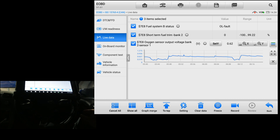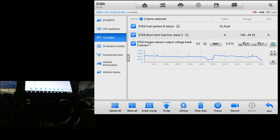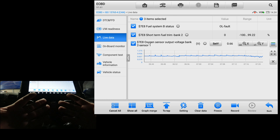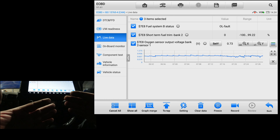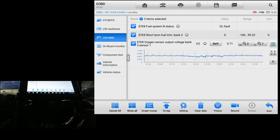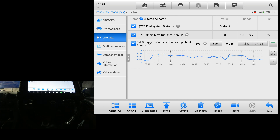Just keep revving - it will take some time depending on the car, a minute to a few minutes. Basically that's the fundamental function of the heater in the oxygen sensor: to heat the sensor up quickly so it starts working. Back in the days they didn't have heaters in oxygen sensors, so it used to take a lot of time before the sensor actually started working. Having a heater makes a huge difference. It's an emissions thing on newer cars - the oxygen sensor can start quickly correcting fuel trims, which is good for the environment.